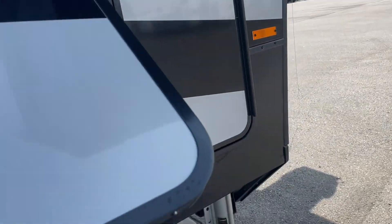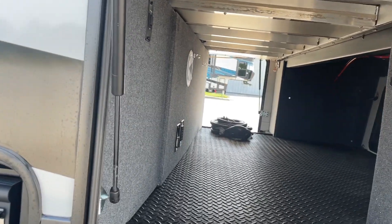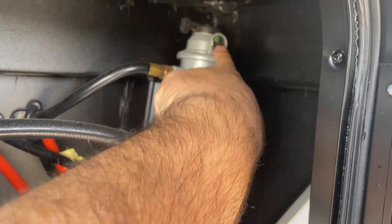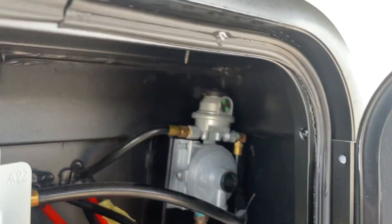Let's open this up — there's incredible pass-through storage here. It's important that one of the first things you do is slide out this first slide. You're going to use this button right here to slide that out. This is very important — you've got to get out that primary slide before you can start to operate anything else. Here's your automatic changeover valve and your gas valve. The green indicator means there's propane running through the lines; that selector determines which tank we're drawing from.